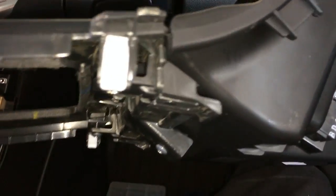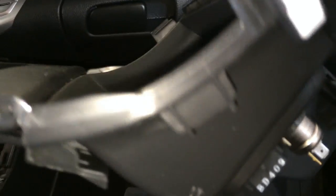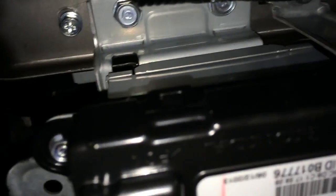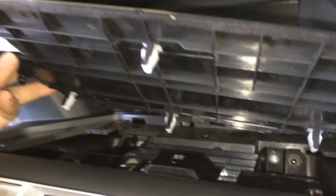Of course you want to pop off the center console. We're going through it really fast — if you don't know these basic steps you should redo this. It plugs on here, the trim comes off, and the under dash right under the AC control has two 8mm screws you have to unscrew. You can take those components off to make it easier but you don't have to. Right on top are just two screws that hold it, this little panel pops off, and the whole radio should pop right out. So let's go.